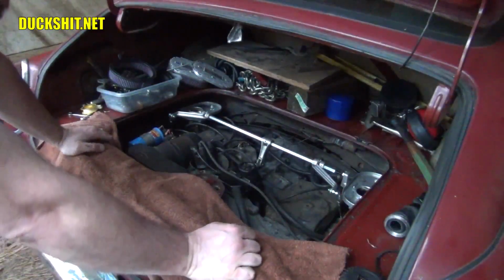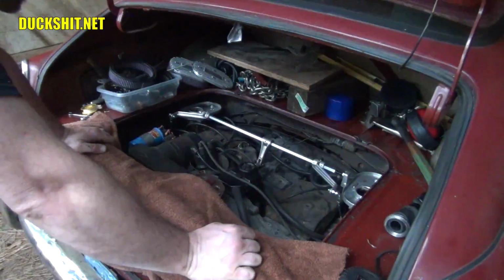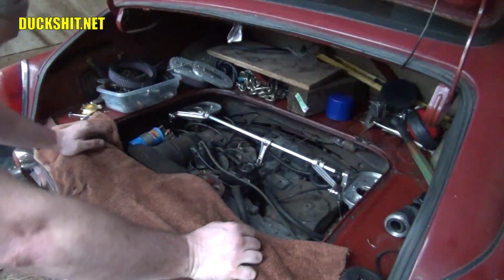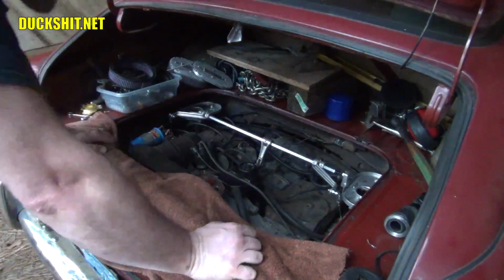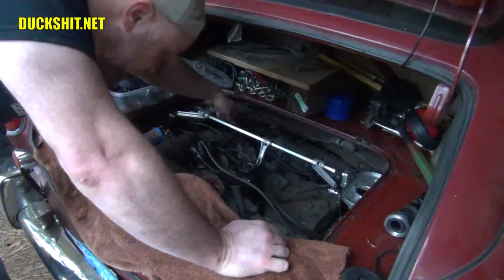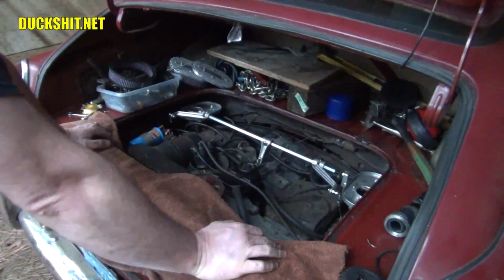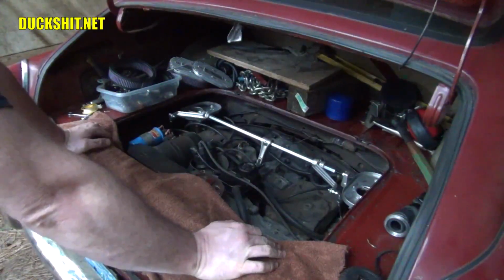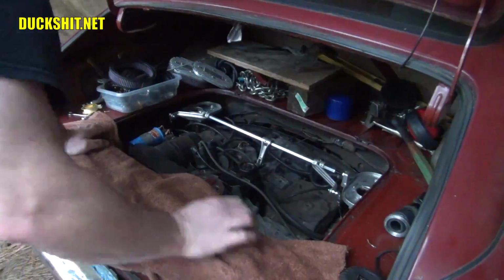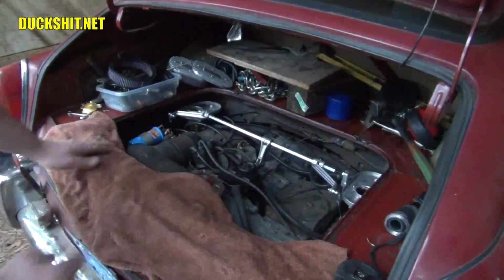All right, we got our power on here. I'm hearing the floats filling up. Smell gas, but I don't see any. No, I'm not seeing any fuel dripping. No, I think we're good in that department. I smelled gas only for a moment, but I think it was just the bowls in the carburetor purging whatever vapor was in there. Okay, let's go ahead and see if she starts. Now my battery's a little bit weak, so I hope it does the trick. We're about to find out.